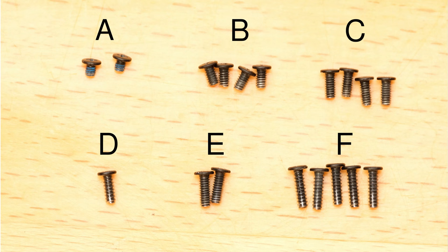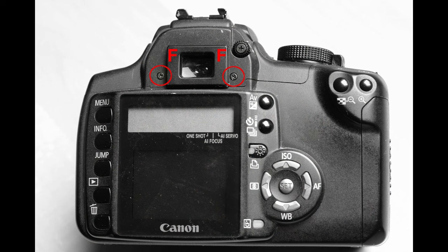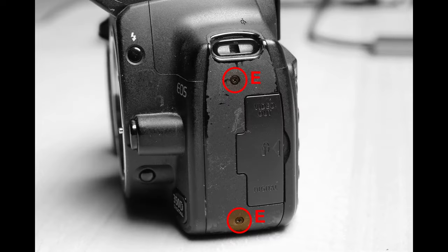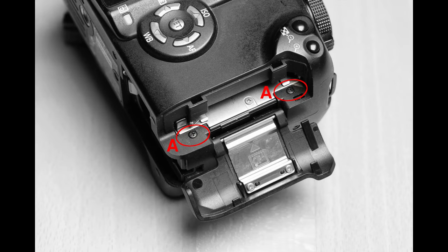First we're going to take off the back cover. To do that we have to remove 18 screws. Here's a picture of all of them, sorted by their size — there are six different types. From smallest to largest, I call them A to F. Let's start by unscrewing those on the bottom: there are six in total — four of type B, one of type D, and one of type F. On the back, next to the viewfinder, there are two F screws. On the top, underneath the connections for the straps, there are two screws of type C, and I found it easiest to remove those with a small magnet. Then on the front there are two F screws, and on the left when looking at the camera from the back, there are two E screws. On the right there are two C screws. Finally, inside the card tray there are two screws of type A. There's another screw in the middle which we'll leave in place for now.